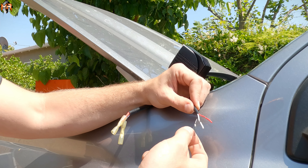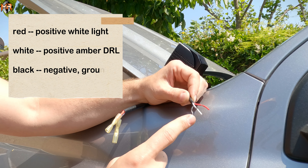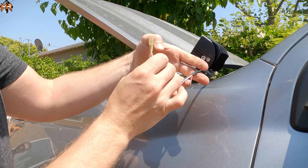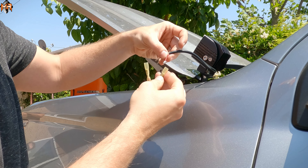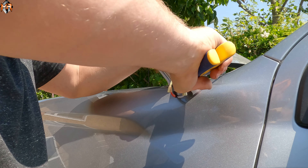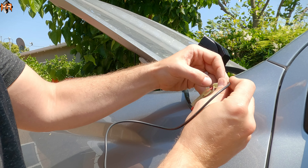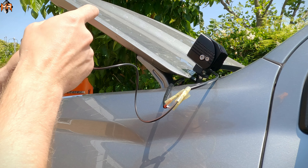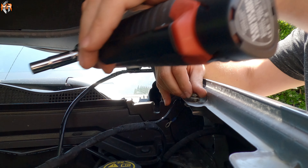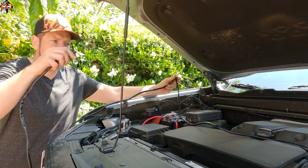For the wiring, the pods come with a red, white, and black wire. The red is positive for the white light, the white wire is positive for the amber DRL, and the black is the ground. On the wiring harness, we're going to pair up the same colors — red to red, using a crimp connector. Then we're going to do the same thing with the white wire. For the black wire, we're going to use the provided grounding strap — black to black on one side. Then we'll use the eyelet on the truck at a grounding point: remove the factory bolt, slide the eyelet through it, and tighten it back up.